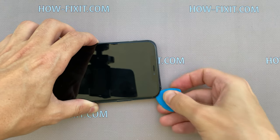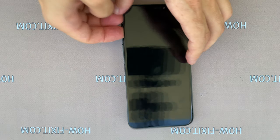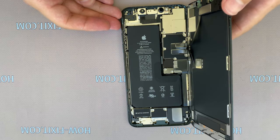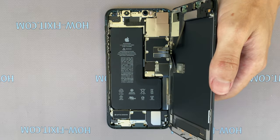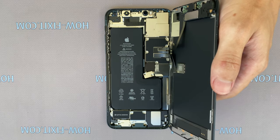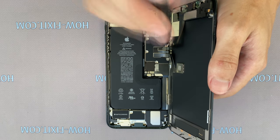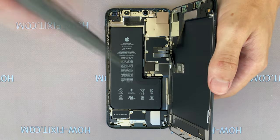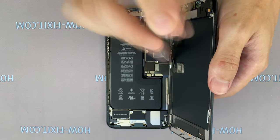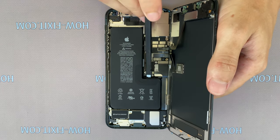At the top of the iPhone, do not push too deep into the device. The case opens like a book, with the display to the right side. Remove two screws on the small panel and six screws on the large panel. First disconnect the battery cable, and then the three display cables.